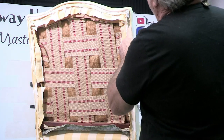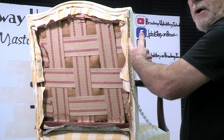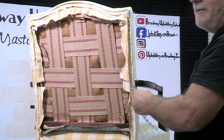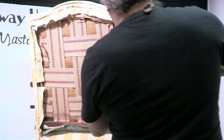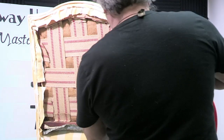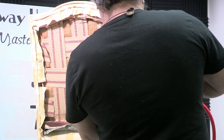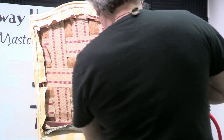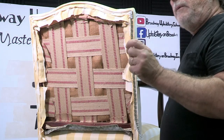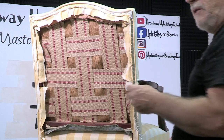What I'm doing is I'm shooting the staple in the hole. These holes were originally designed for six-ounce tacks when ply grip first came out, and then everybody uses stapling now. So it just happens that the staples we use — the length works pretty good with that hole. Isn't that interesting? They didn't design it that way, but that's how it ended up. I suppose if they redesigned this ply grip, they might make the hole a little more rectangular for the staples to go in a little better.